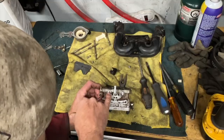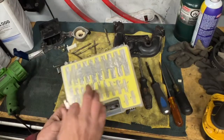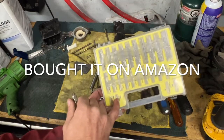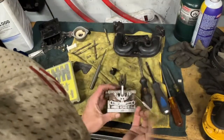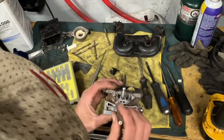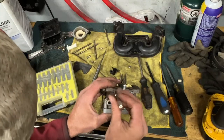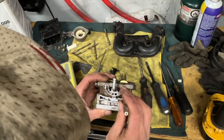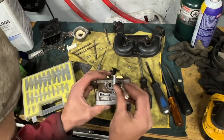You can drill those holes one size bigger — that might help. I've got a bunch of drills here — starts with 0.4 millimeter, 0.5, goes all the way to 2 millimeter. I already put a 0.8 millimeter through these holes and it went pretty good. So this is 0.9 and I feel a little bit of resistance there, so I'm just turning it in. I don't really want to drill them out too big.